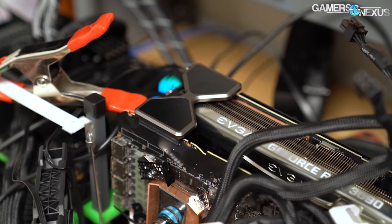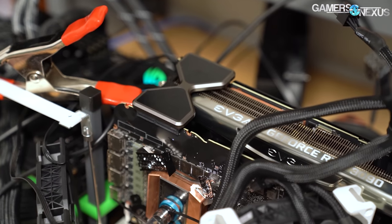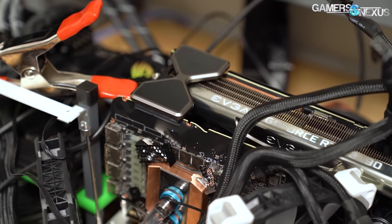There are a number of issues we ran into, like the SLI fingers on the cards not lining up — it's not standardized, so they're in slightly different places on different boards, not just vertically but also horizontally. The limitations for SLI these days are more strict than ever, as Nvidia has officially dropped SLI support going forward, so now only things with explicit multi-GPU or mGPU support will actually run two cards. We had trouble running some games that don't technically require a bridge without a bridge.